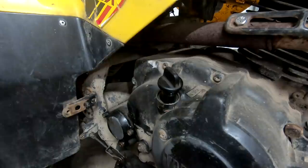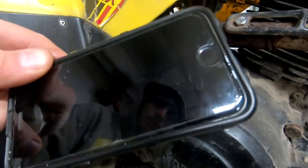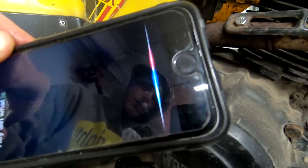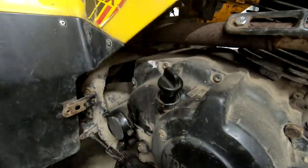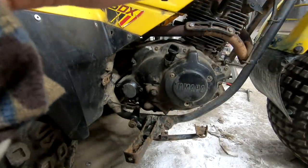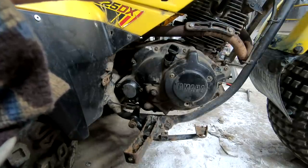It says 4 ounce or replace 20%. So — Siri, what's 20% of 1.75? You've got to be quicker than that. What is 20% of 1.75? 20% times 1.75 is 0.35. So 0.35 — now I've got to look up what 0.35 of a quart is equal to in ounces. 0.35 quart — it looks like we're looking at 11.2 fluid ounces.